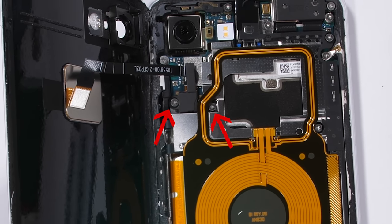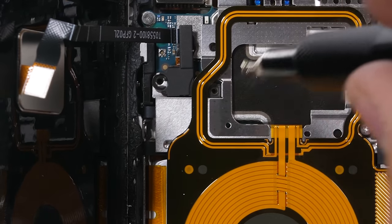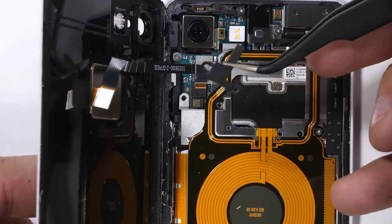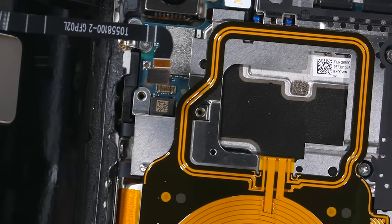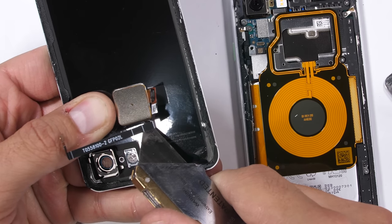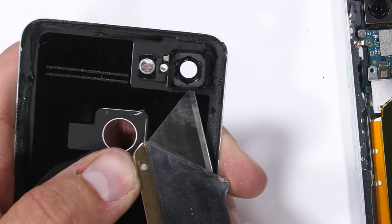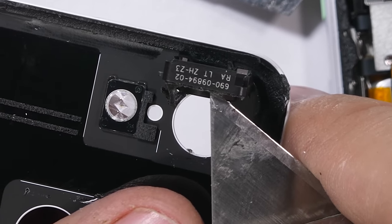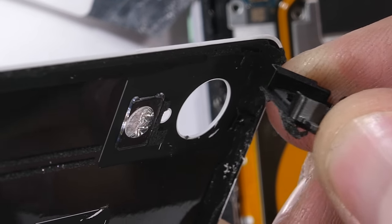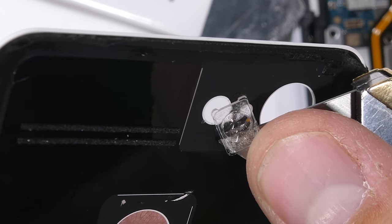There are two silver screws holding one little plastic bracket covering the fingerprint scanner ribbon cable. I'll unscrew those and set the black plastic bracket off to the side, then unclip the ribbon cable like a little Lego with a plastic pry tool. The fingerprint scanner is adhered to the glass with the same waterproof adhesive found around the edges of the glass panel. The camera lens is a super simple square also adhered with the same black adhesive, and the dual LED flash diffuser is a tiny clear piece of plastic with a smidgen of clear adhesive holding it to the glass.